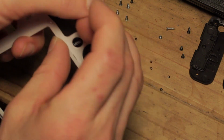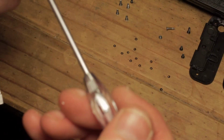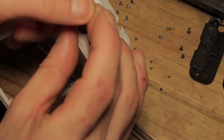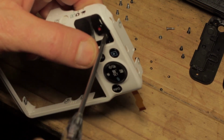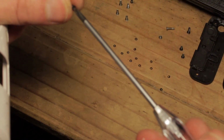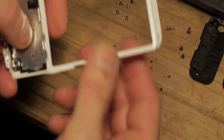So lift up the rubber thumb grip, again just the edge. Take your screw that holds that in place. I should have gotten that ready first, really. So screw here until it nips up tightly. Push your rubber thumb pad back. That's the top section in place, and then we'll take the screw for the lower section, bending the ribbon cable carefully, not too aggressively. Put the lower one in, which will hold that firmly in place.